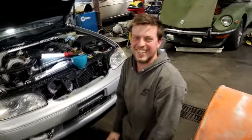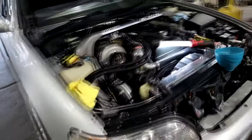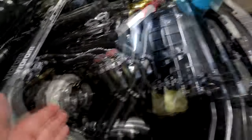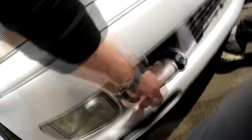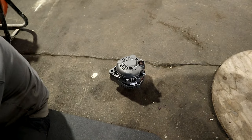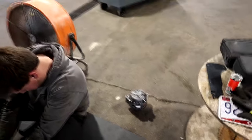So let's go talk about what we're actually going to do. The intake's already out because of the HD clamps. All the charge pipes are on HD clamps. However, we have to get our arm all the way back in here. We've got to get that charge pipe right here out so we can get to the alternator. And then we're putting a Sequoia alternator on this thing — it's higher amperage and it fits pretty good out of the box. It's not perfect, but we're going to show you how to do this.